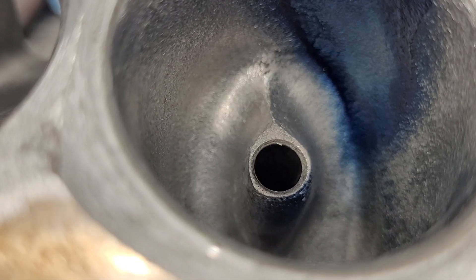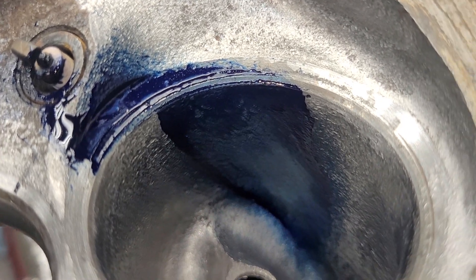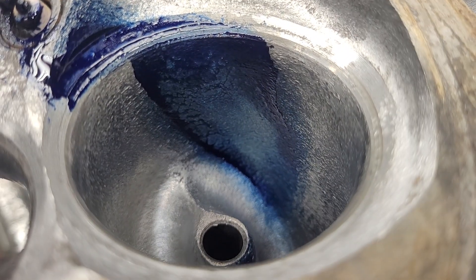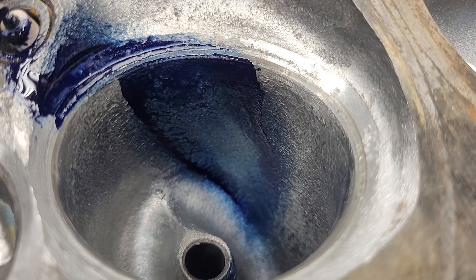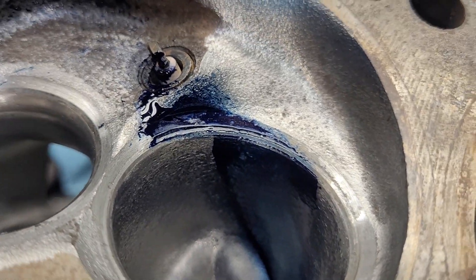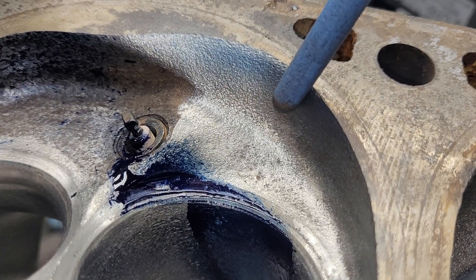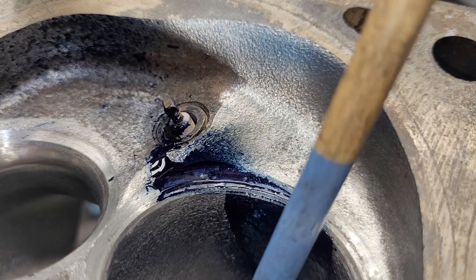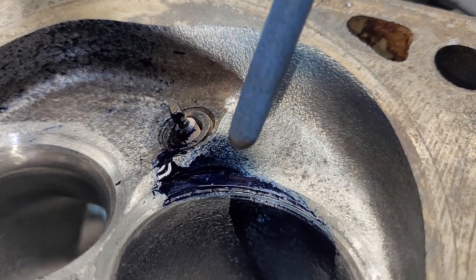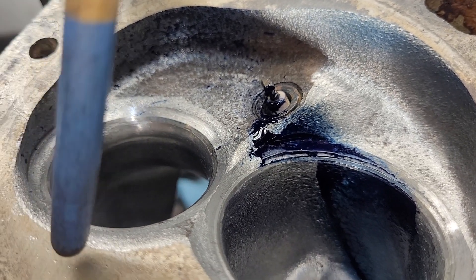You can see a bit on the guide. We've got a nice wide swath on the bowl itself, but look how thin it is on the bowl — you can almost see right through the blue. We've got some chunkiness around the plug, some light blue here where it shows the fuel. The Dykem is actually going past it, and we've got splatters all the way around.